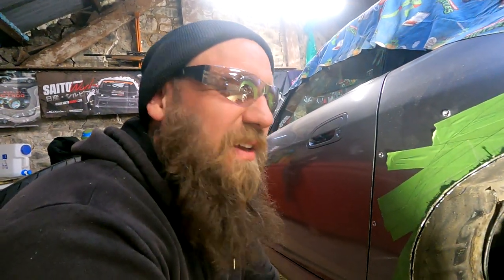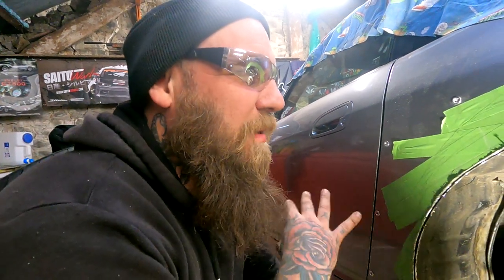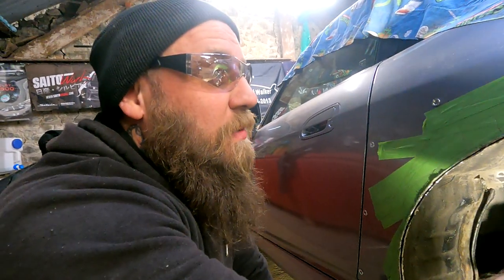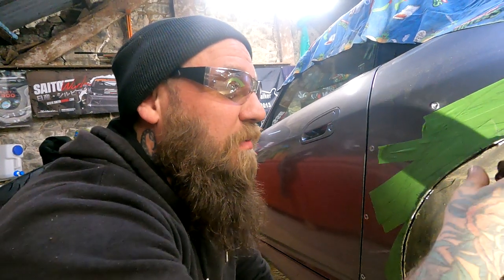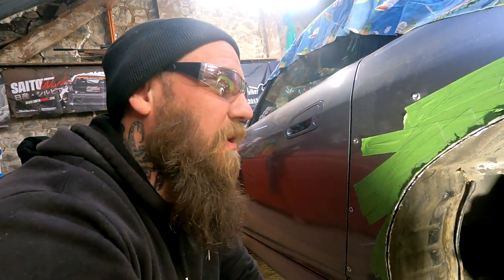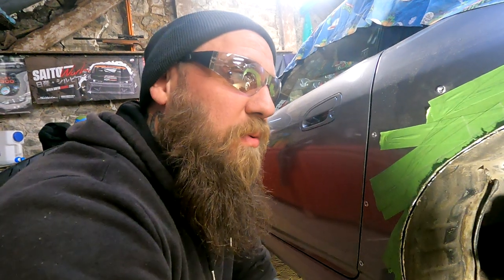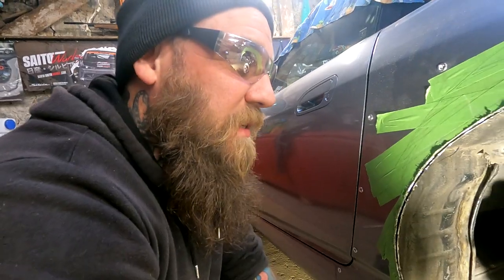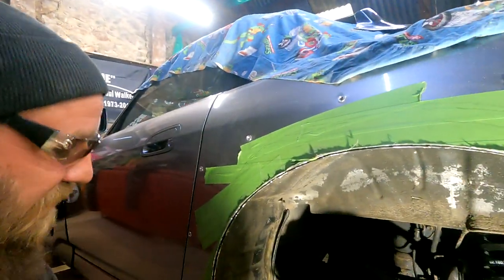The welding is going to be a separate video, I think. Yes. So we'll cut it out, get it bolted on, make sure that it clears and everything, and then the next video will be tack welding it all up. Because the metal is so thin, we'll try to weld it along, but if we can't, then I've got loads of seam sealer, so we'll tack weld it up and then seam seal it. I was going to prime it all as well. You might as well, since you've got all the stuff, because it'll rust otherwise. You need to paint the bare steel edges because they'll rust.